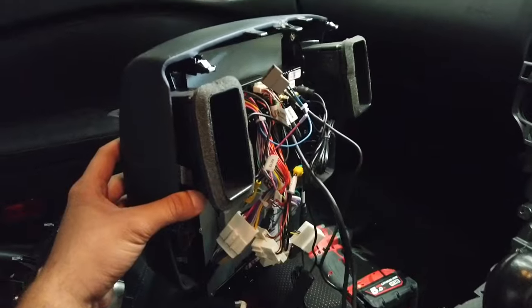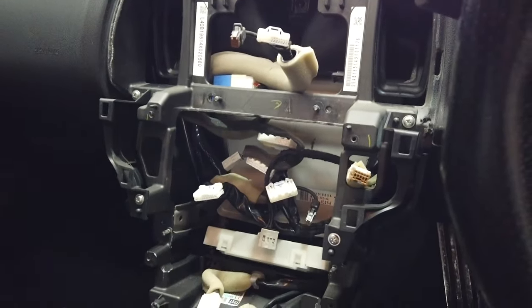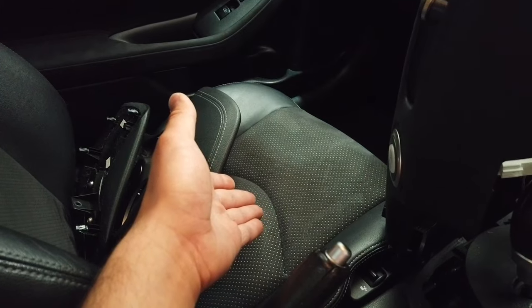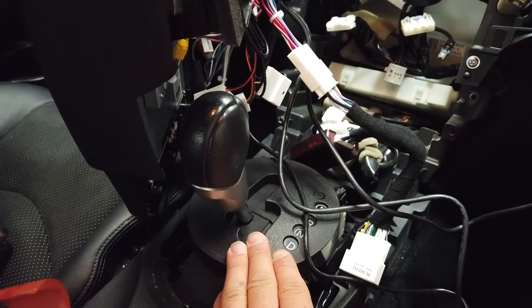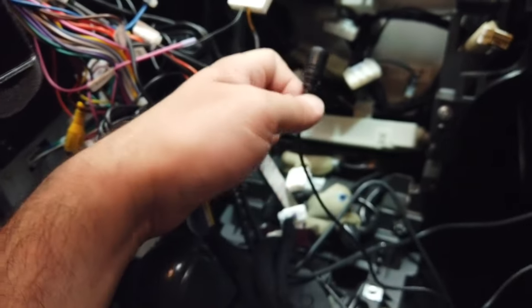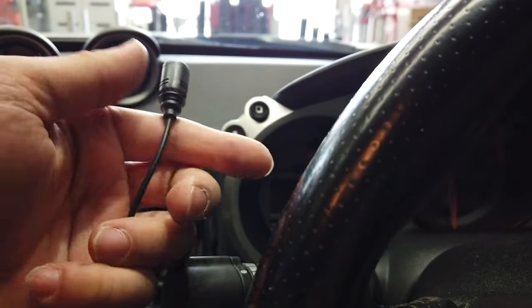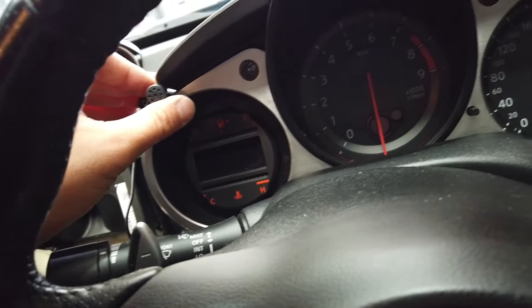I can go ahead and put this aside. This part is usually the most difficult. Best way to go about it is to bring the Tesla unit as close as possible to the corner here so you can reach the connectors on either side, and then slap on the Tesla unit last. Go ahead and connect all the connectors first — bring the passenger chair forward as much as possible and bring the Tesla unit as close as possible to the connectors. The microphone — bring it out from here and then up the steering column and place it in this section for the best quality so people on the other line can hear you well. I would usually place it just here — it's out of the way and not annoying.